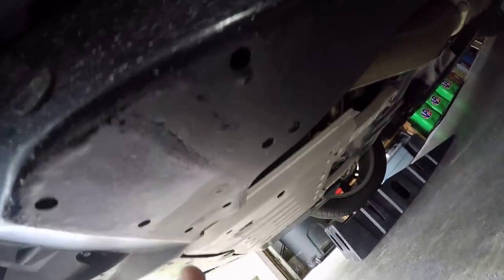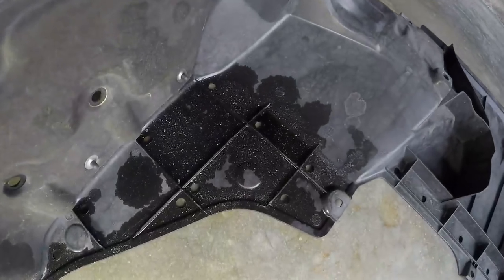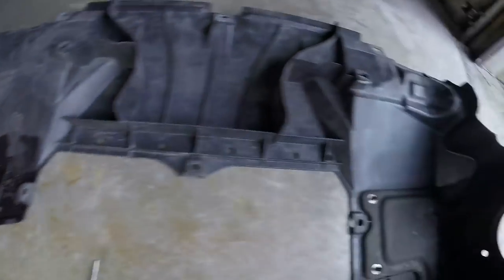Let me pull it up here and we'll take a look together. The leak does look worse. It's just an oil leak — somehow it can be fixed, just a matter of figuring it out. Maybe the sensor itself is leaking, as someone suggested. That's why the o-rings don't work. It looks like a pretty solid sensor; I don't see how oil can go through the middle of it — it's a magnet block on the end, I'll show you. That's a pretty bad leak guys. It may have been because I put way too big an o-ring in there. You can see almost a drip right there; right above it is the sensor we're talking about. Let me do the last two bolts and get this cover off.